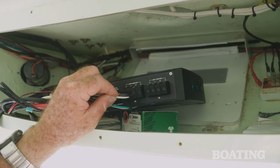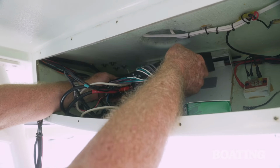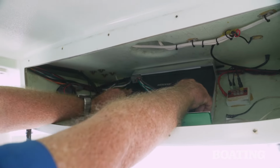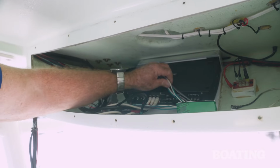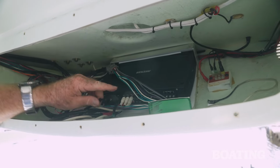It's now time to connect the speakers. The E-box above provided tight quarters for mounting and ultimately adjusting the amp, so we fabricated a bracket that eased securing and removing the amp. We glued it down with polyurethane adhesive.